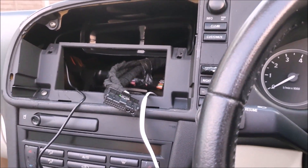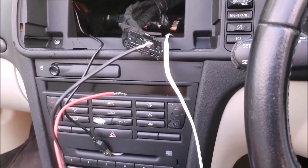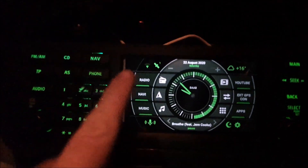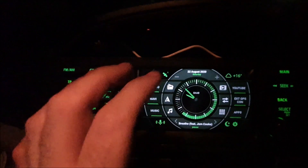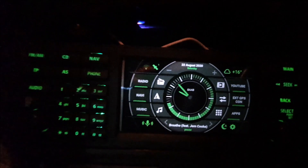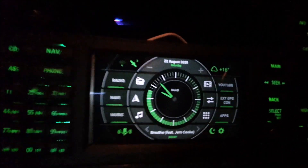Remember, follow the other video on how to connect your live and ground. Just to explain the external GPS device which is flashing away out there — if you are wanting to navigate, you can see how many satellites your phone is connected to. It says one, and that's because this phone doesn't get a very good GPS signal whilst it's built into this head unit, and that is the reason why we need to have the external GPS device.